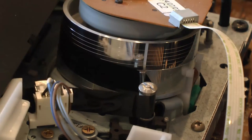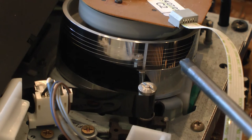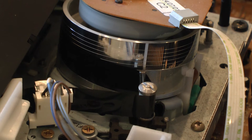On some more modern machines — and actually inside the Sony I took apart yesterday — there's a little cleaning arm. It actually comes in from the back, over here, and goes into the actual video head and cleans it, then goes back out again. It does this every now and then to keep the video head clean, and they somewhat work. But of course the video head cleaner is inside the VCR, so after time it's also going to get dirty, and it's then going to be transferring that dirt back to the actual video head itself. So it's not exactly the ideal situation.